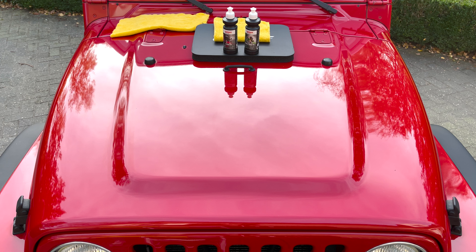We're going to tackle the scratches and swirl marks on our car with coarse polish first, and then finish with fine finishing polish to get a showroom gloss. This car clearly needs it — it hasn't been polished in over 20 years. However, when your car paint is in good shape, you want to start with a soft foam pad combined with fine grade polish and evaluate the results as you go. It's always smart to start with a fine or medium polish and use a more aggressive one only if needed. The less paint you remove in the process, the better — because it doesn't grow back.